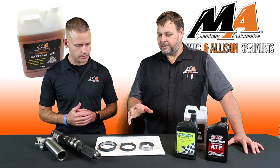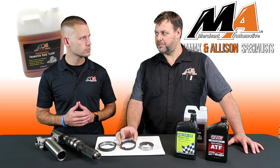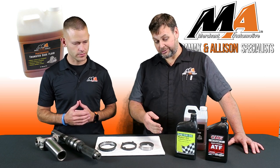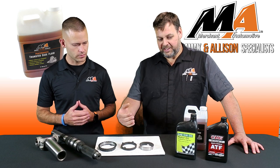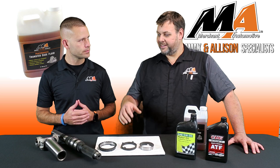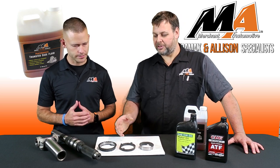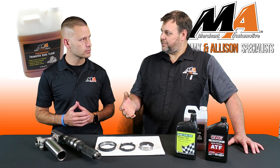An engine, by comparison, has a lot of demand, but it doesn't have any friction material, and that presents a challenge that the engine oil just simply can't address. So while it's great for an engine, and it will lubricate a transfer case, it's just not the right stuff. It doesn't have the properties we need. And as far as overfilling it, to me, that's just foolish.